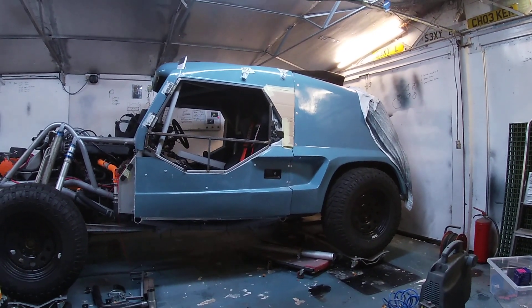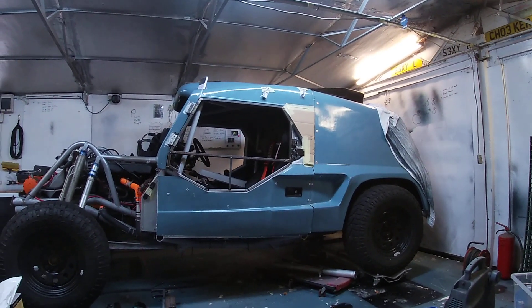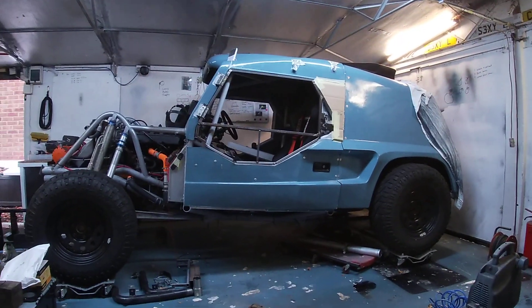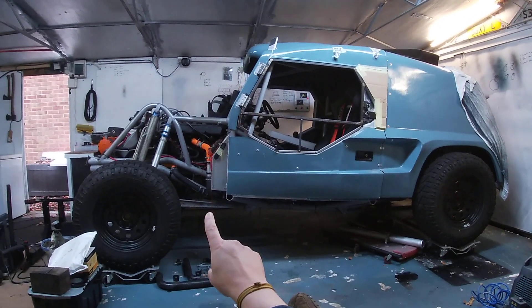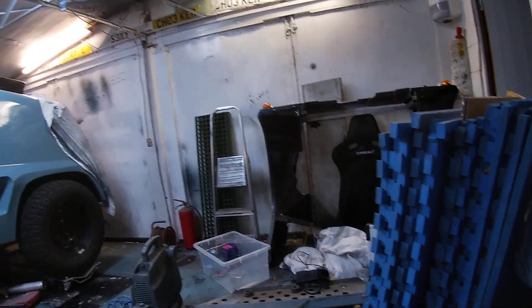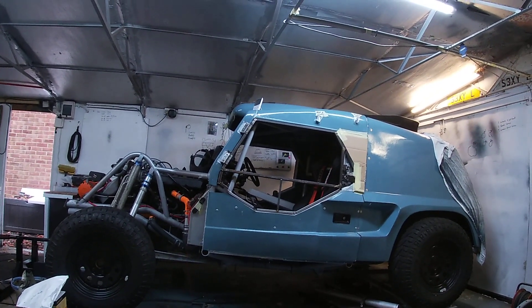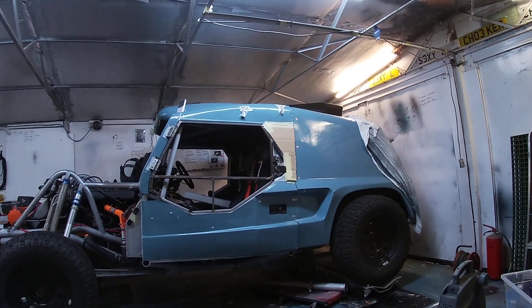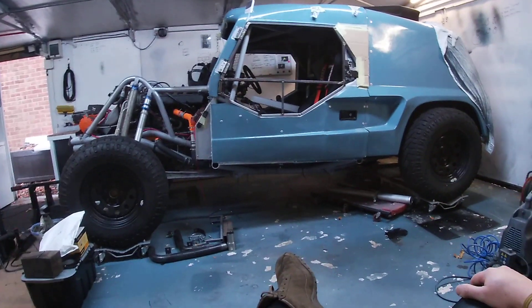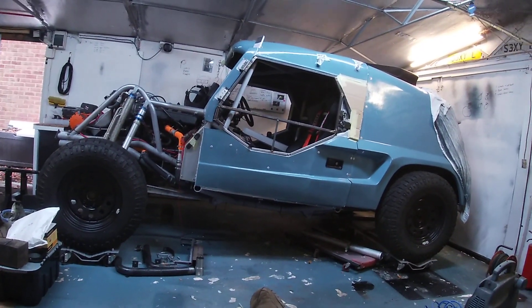I'm using the Ashcroft transmission interface plate system to an automatic gearbox that was modified to work with the LT230 transfer box. We redid all the mounts, welded up and finished aspects of the chassis that needed modifying, built a front end for the car which is sat over there in the corner, worked on the interior, some door frames, and structure for the rear.